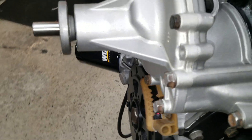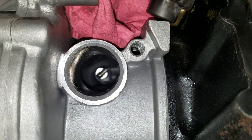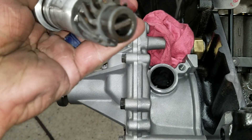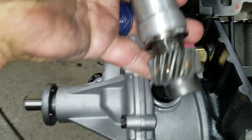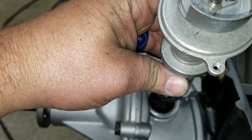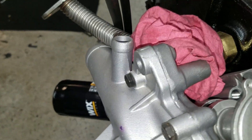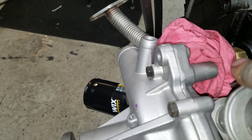Once that has been determined, take note of the shaft. These guys got to line up. But you can't put it in there exactly the way it goes because of the way the teeth are cut, so you have to advance it just a little bit. Then you're going to push it down in there and hope that it seats. Chances are it's not going to seat without a little bit of persuasion because of that O-ring.